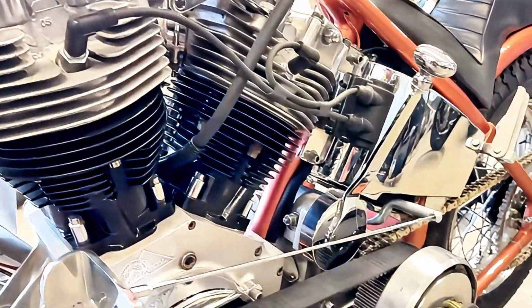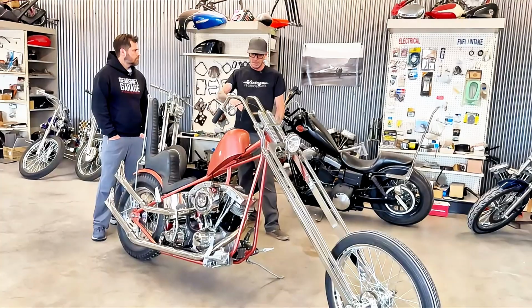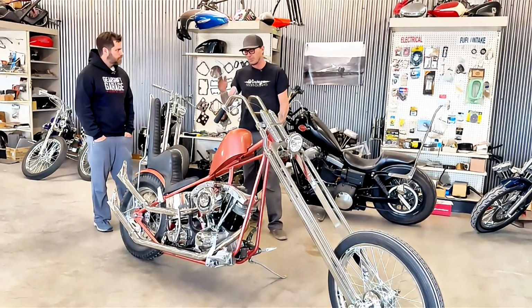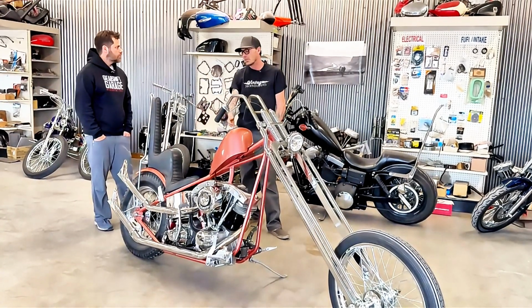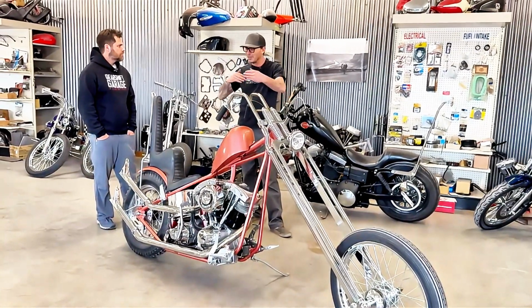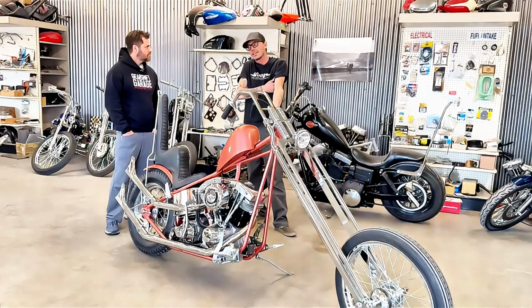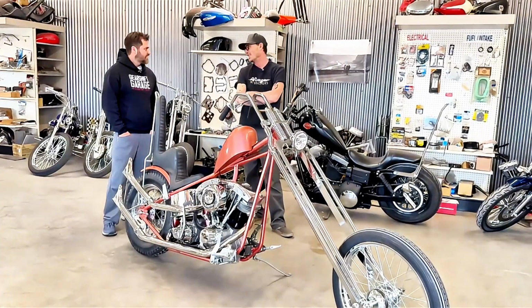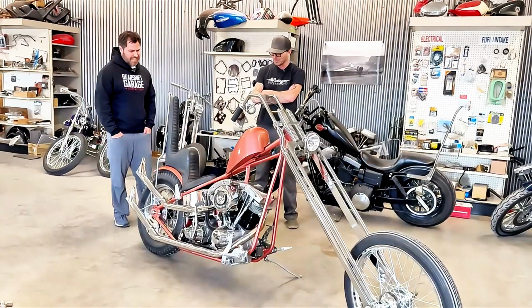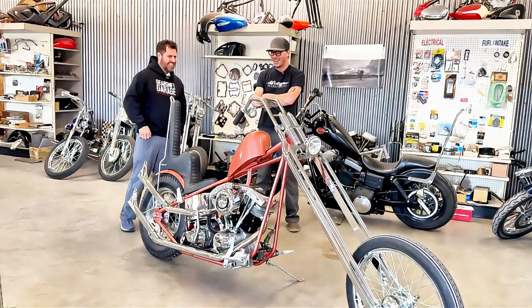I incorporate on my personal bikes Harley Davidson's original rocker clutch, which is a foot-operated clutch, but it has a cantilever type spring. You can lock your clutch in and put your foot down, and then simply put your foot back on it, rock it, and go without having to touch the shifter. A little bit more mechanism, and again, some people have a learning curve with that because it's kind of backwards from this style. This is exactly like a car, but if you are not paying attention and have neutral, you're gonna realize why they called it that real quick. I've done the same thing. You come to a light and you go to set it on this side, and you're like, "Uh-oh, I gotta go." Sorry, running the red.